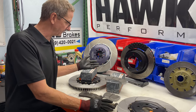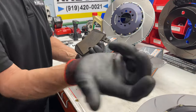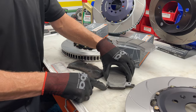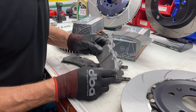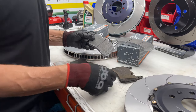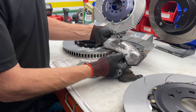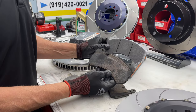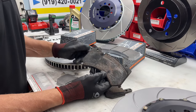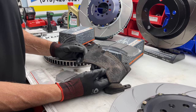We've got the brake pads on the bench to compare. Not sure what GM was doing with that extra stuff on the OEM pad — maybe to help pull the pad out. The pin goes through the lower hole. We don't have a squealer on the race pad; we do have a small relief for the sensor but no actual sensor notch. On the race pad we do full coverage — no chamfer. We do put slots in there to help with some noise, but it's a race pad so we don't care too much about that.